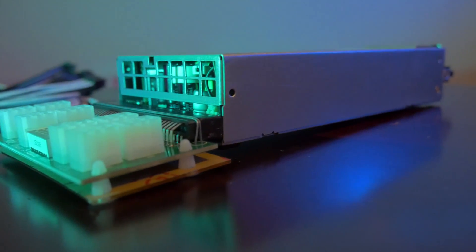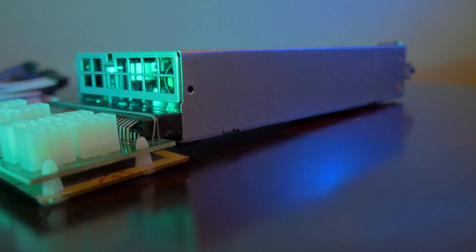Once you're done with that, you can plug up your GPUs, plug in the power supply, and you're good to go. One thing to note is that the rest of the components in the system itself will have the issue of powering on separate from this power supply. There are options to adapt a 24-pin CPU power and 8-pin CPU power as well, but I haven't looked into those yet — we'll have to check it out in a later video.